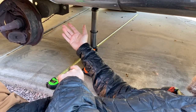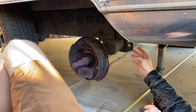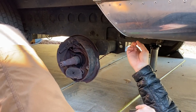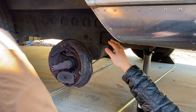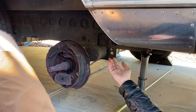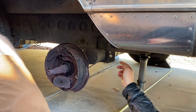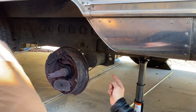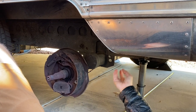Because our Airstream is old and the way we had to mount it, the flange on the axle has to go up and then in. We added a lift kit, so the lift kit is going in right here, and then the axle is actually bolting straight up into the bottom of the lift kit. We have to have a piece that goes up and then across to bolt into.